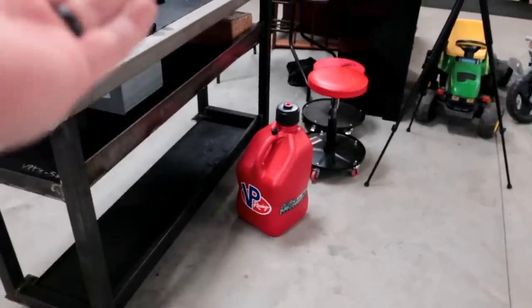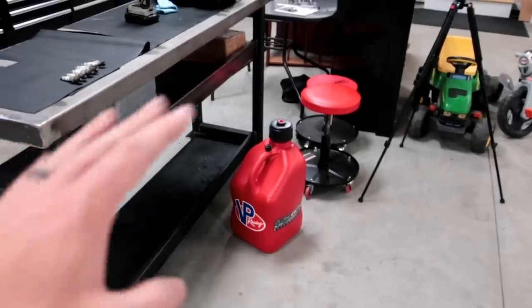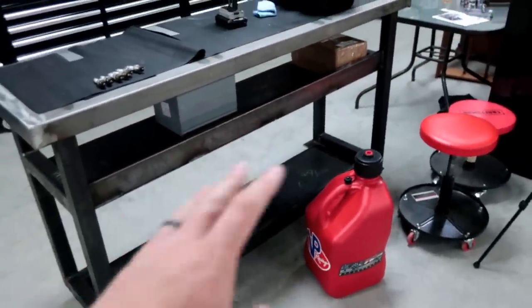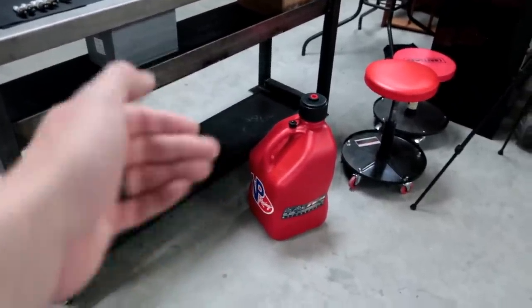The reason I'm getting fuel ahead of time is I'm going to run the car first on 93, then after we get things tuned in and make the fine refinements, we'll switch over to E85. We'll dump out all the fuel in the car, push all the fuel out with the pump on, and dump in E85. If it is E85 — at this early time of year it's most likely E70 in there. So what I had John do was order me a pail of E98. His idea was: go down to the local store, put the pump E85 in there, drive up, and keep adding E98 until the content reads E85 or E84, then stop. That way if the pump reads exactly E85 in the summertime, you're already tuned for it.